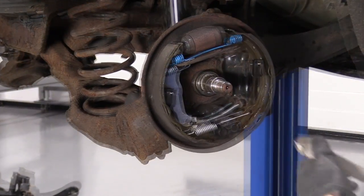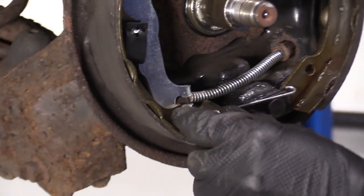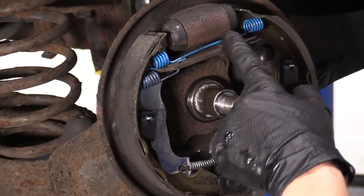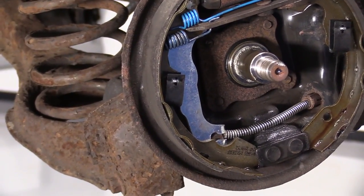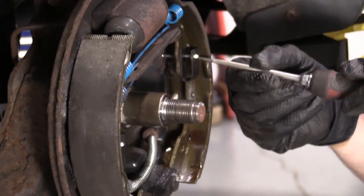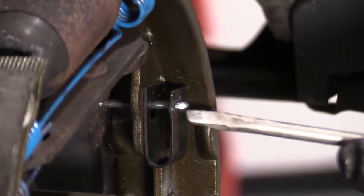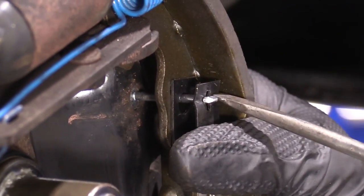I'm going to use my cutters — not to cut, but to grab and pull the lower spring. You want to make sure you have safety glasses on throughout this whole project, but especially here. I'm going to press right on this spring clip and turn the pin in the center so it's straight up and down — it'll line up with the slot on the spring clip. Once I do that, there isn't going to be anything holding it from flying back and hitting me in the face, so I'm just going to be careful. I like to go along the shoe side with the screwdriver — the shoe kind of holds it so I can't slide off very far.